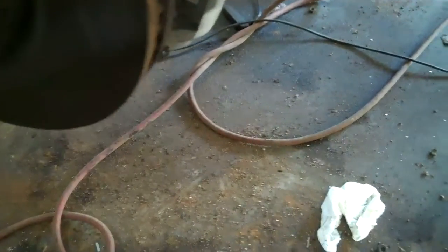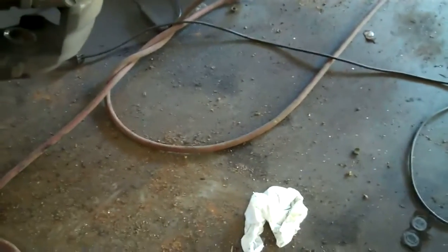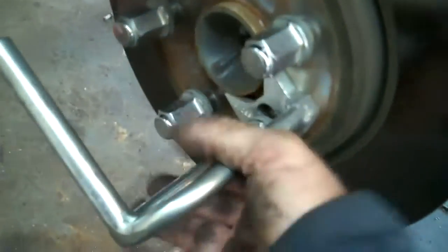You want to make sure you get your brake rotor torqued down to specs, which on this is 95 foot-pounds. Make sure you put your attachment on here, then we're going to put our lathe attachment — I had to make a bracket — and then we'll get it hooked up. Alright, we've got our first lateral bracket on, we'll go ahead and get the machining part off.